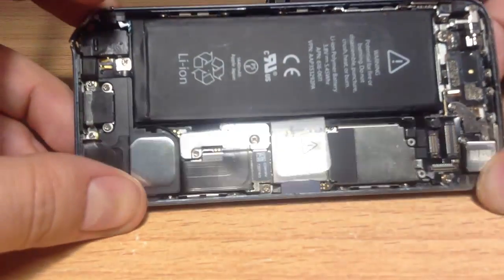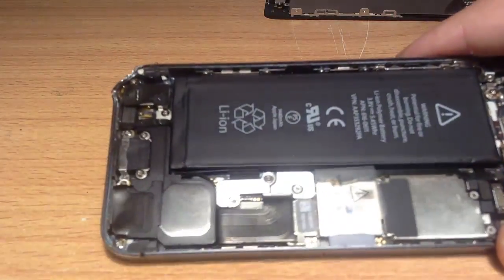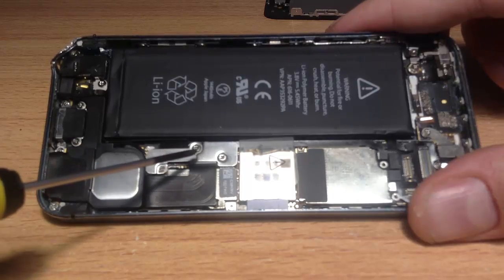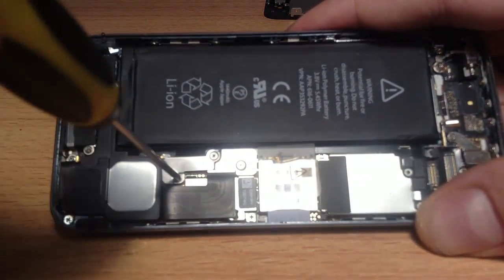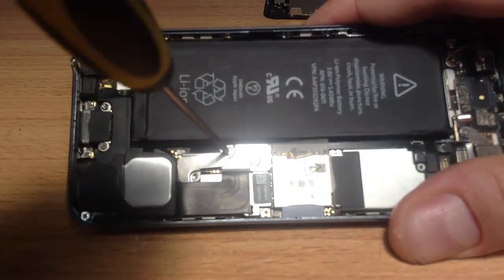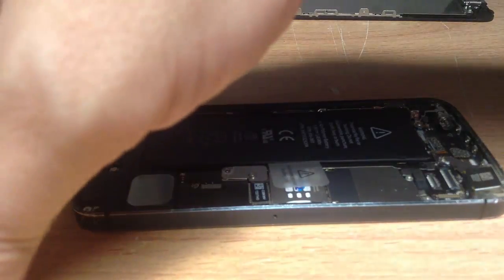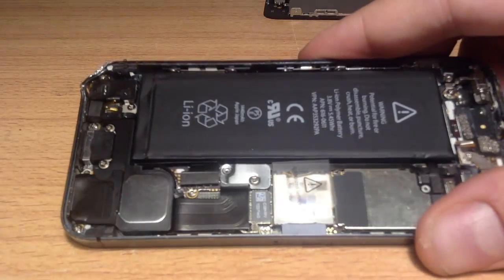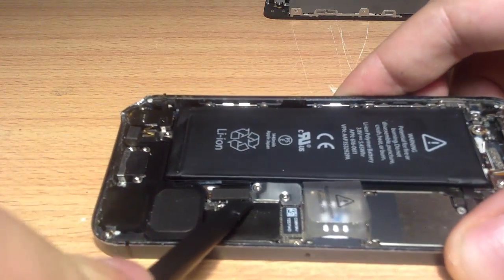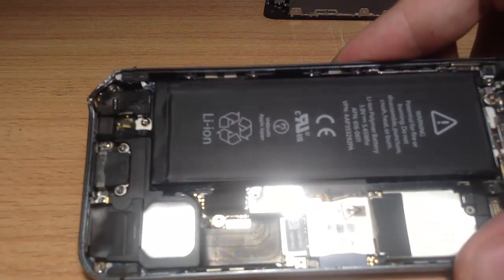The battery is screwed on with the connector and the metal plate. There are only two screws you need to take out — the far left and then one in the middle. Take the first one on the far left, put that aside, then do the next one and the metal plate will come off with it. Lift that off to expose the connector for the battery. With a spudger or a skewer — something non-conductive — get under the clip, lift it off, and the battery is disconnected.